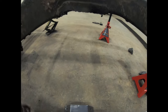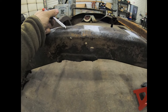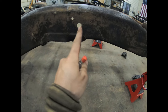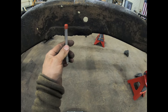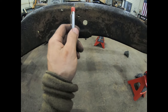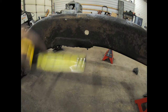It's pretty rusted. For starters, if you have your vent here you can remove it. Then you're going to want to locate the center hole here, which is the axle centerline. Your bump stop is actually about three inches in front. For the notch, we're actually going to come an inch and a quarter in front of the centerline.